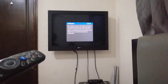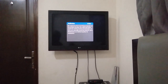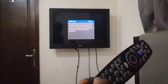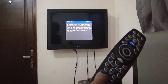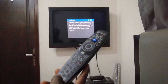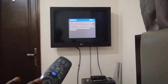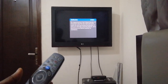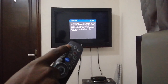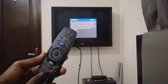I'm going to show you the one for LG because the one I have right here is LG, and I'll mention Samsung as well. Basically it works for most TVs — you just have to go through the numbers from one to zero. For Samsung it's seven, for LG it's four, and some might be five. Now, the buttons that are dual-signal configured — meaning you can use them for both the decoder and the TV — include the power button for your TV and the power button for your decoder, as well as the volume rocker.